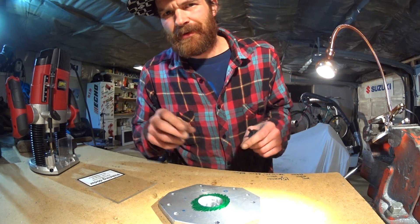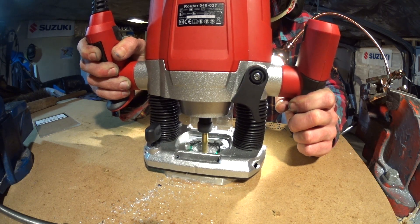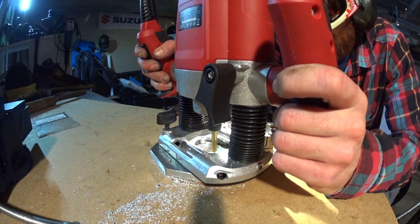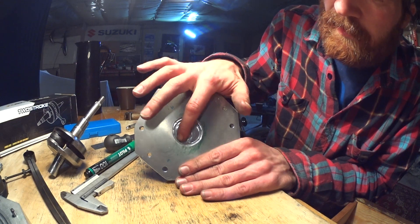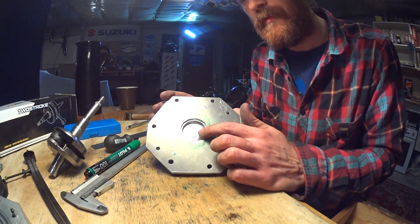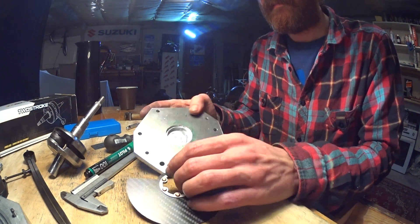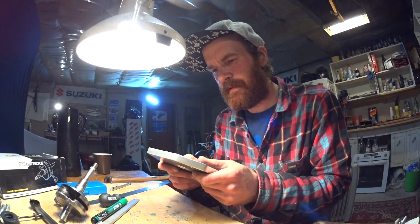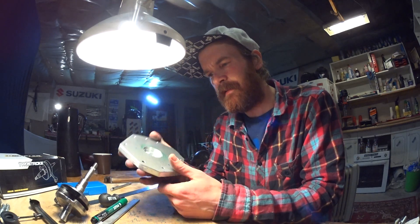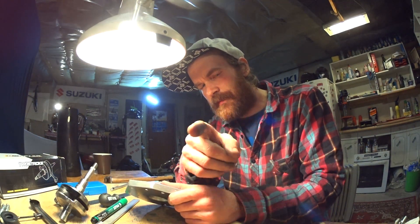I've scored a new line, set it to three millimeters depth, and I'm just going to go around carefully cutting out what I need. It didn't turn out too bad. Of course it would have looked prettier if I had measured right the first time. What I did wrong was I subtracted five millimeters but didn't think of it as five millimeters per side. The valve fits nicely — perfect. Go check out Emmott Racing for super awesome racing parts, and milling soft metal with a handheld wood router works just fine. Thanks for watching, please subscribe and I'll see you next time.